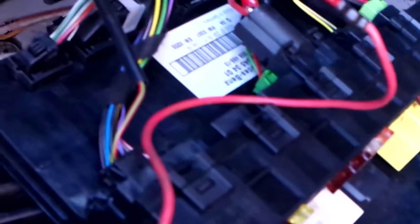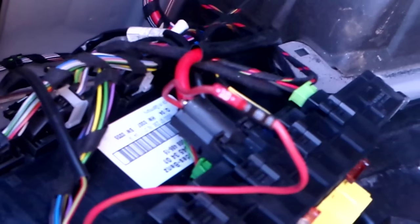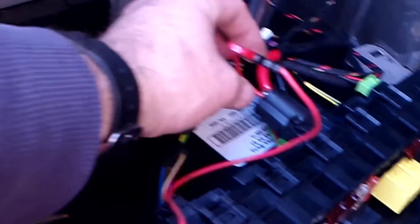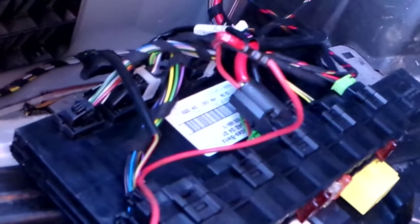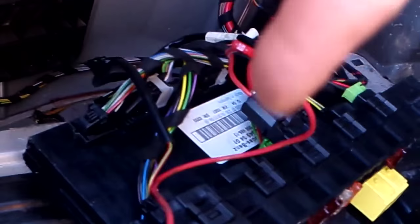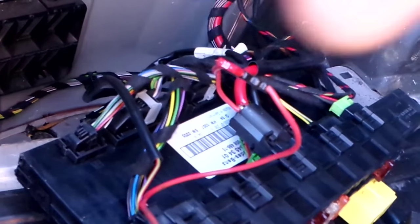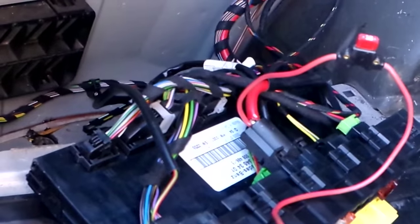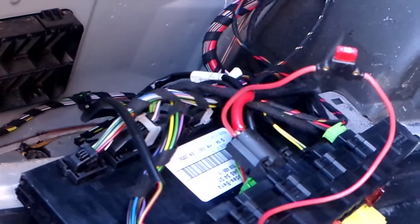I guess my radio was on. I'm going to hook this back up and then we're going to probe for wires for the brake and tail light and stuff. This is where the converter goes. We're going to find a suitable ground — that's simple enough. So step one is power from the SAM unit. I'm going to put this back in and be back in a minute.